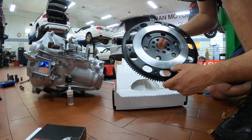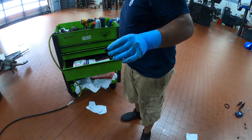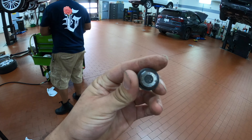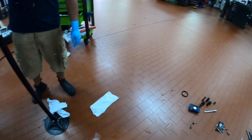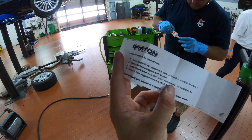So I went with the Action Clutch Stage 3 with a lightweight flywheel. We torqued them down to specs, believe it or not, and it still backed out. But since we have performance parts we can't follow those rules - look right here, it says they're factory bolts. The first time around these ones you've got to torque them to 110 foot-pounds.